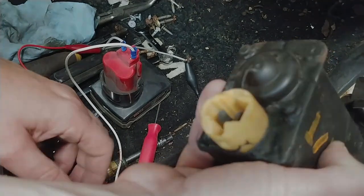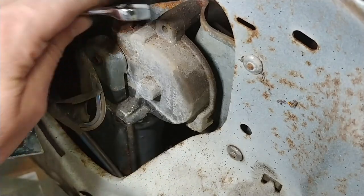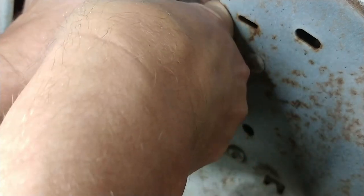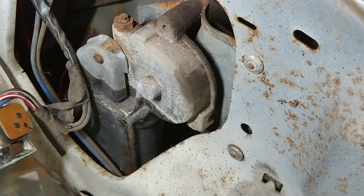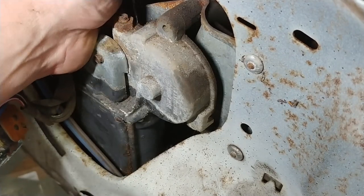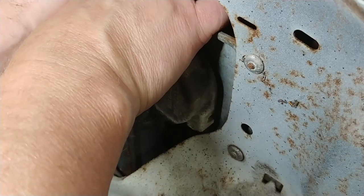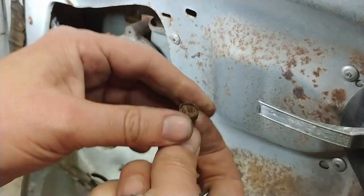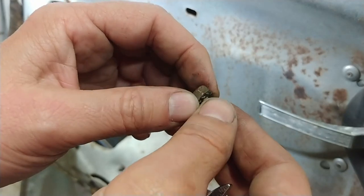Be aware there are two different plug designs. This window motor has three 7/16 bolts that hold it in and you really have to work your way around to get them loosened — there's not a lot of room. I've got some shorty wrenches to work with. The bolt has a serrated washer on it that helps lock it into place.